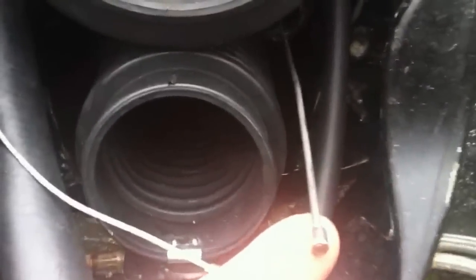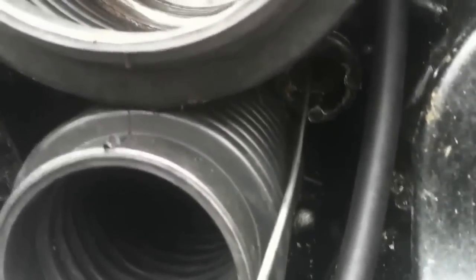That jubilee clip is done up through a hole in the side with a long screwdriver. That's all pretty straightforward. Here we have the mouse which is going to pull my shift cable through - it's going up through the correct route up beside the engine inside the boat. I haven't put on the shift bellows yet because you would not get the end of the shift cable through if it's been glued to the transom. It's a real pig to get on the end of the shift cable and I'll show that on the next video.